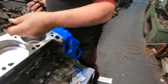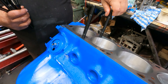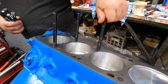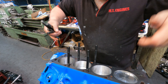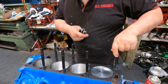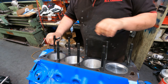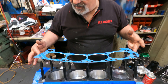So that's what we're going to use. Finger tight and pop them on - I've got to get the dowels. Now the idea of the allen key on the head studs is: say you've got this in an engine bay and you blew a head gasket. You can't lift the head out because it hits against the body of the car. So they've made them like that so you can put an allen key in them and unscrew them, take the head studs out and slide your head out. That's why they're there - smart engineering. Imagine trying to get it out when it's stuck - you'd be pulling your hair out just to change a head gasket. Studs are in.